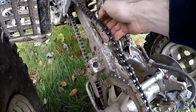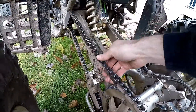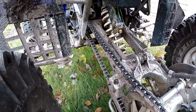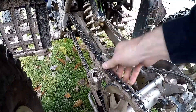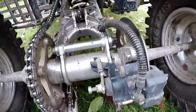So I'm gonna show you guys how to tighten it up. This is how much travel I had when I bought it — that's a lot of travel. The dealer recommends about 1.6 inches of travel, so I'll probably put it between an inch and a half to one inch. When you sit on it, it's gonna tighten up a little bit.